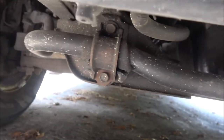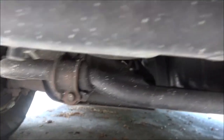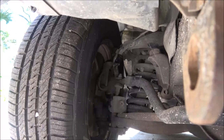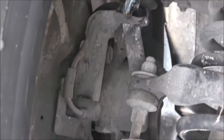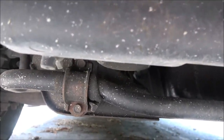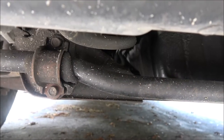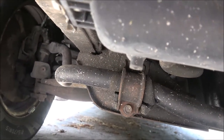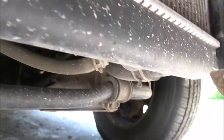Right here's one of the bushings that's bad. I kind of rigged it up before because I had the wrong bushings — that one doesn't look too bad. But of course we'll get them both and change them both. You also have bushings up in there holding things into place. There are two on the top and two down on your lower control arm. What this does is it keeps the truck from leaning — if you're going around a turn it keeps it from leaning and keeps it more stable. That's why it's called the stabilizer bar, or stabilizer bar bushings.